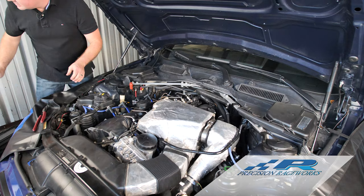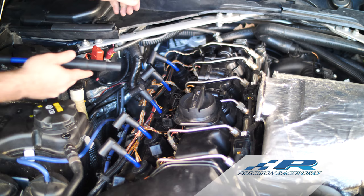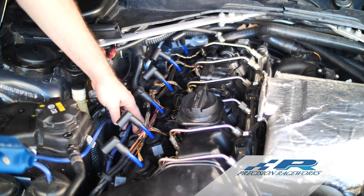We've got four of the plug wires in — just installing these last two now. Feel around just a little as you push it in, push down, get a nice firm engagement. Cylinder six is a little bit more work, especially with the M3 strut bar sitting tight up against things down in here, but it slips in behind there. Once we've got the plug wires in, the next thing to do is install the actual row of coils themselves.